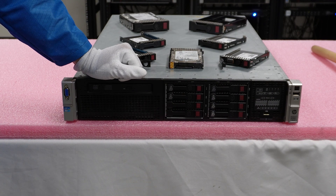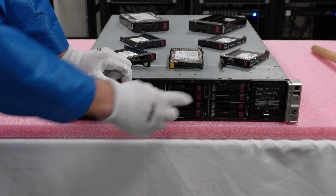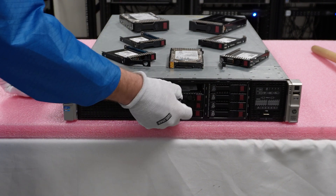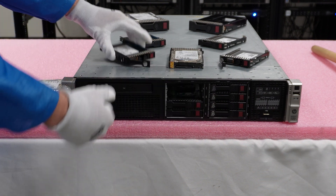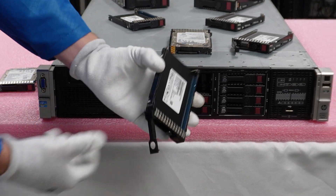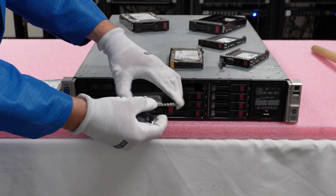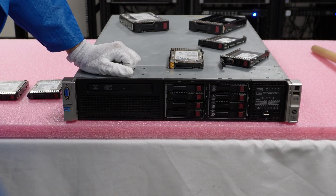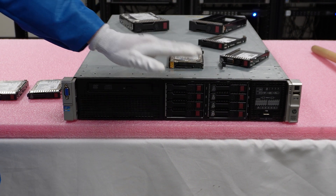Now that I have my ESD gear on, we're safe to work on our DL380P Gen 8. First things first, we're just going to remove our old drives — just the top two since that's the easiest right now. These are some old 300 gig 10k SAS drives. Great drive back in the day, but a little bit obsolete; we definitely want to increase performance on our Gen 8 and extend the life. The best thing we can do is install a new SSD, so that's what we have here. You'll notice we have the correct bracket — when you order from our site you will get the correct tray that you need. It's really easy to install: you just slide this in and when it gets to the end, click it into place. Very, very easy — one of the quickest installations and one of the best things you can do to extend the life of your machine.